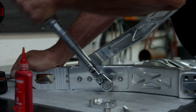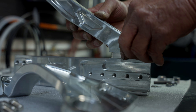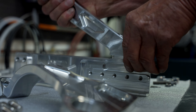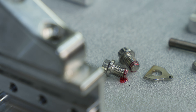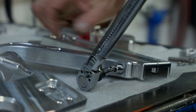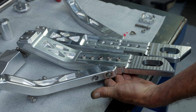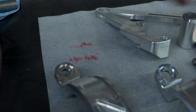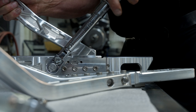Again, it's all modular. The bracket fits into the arm and is locked in place by the billet itself — the fasteners merely hold it together. We're doing the reverse step on the left side: the upright bracket and axle support. You have a left and right assembly. Run those down and torque them in place.